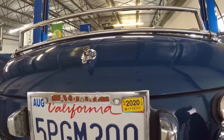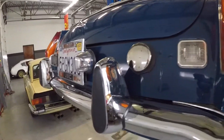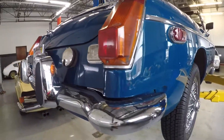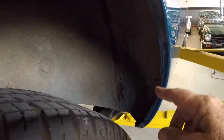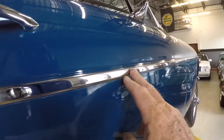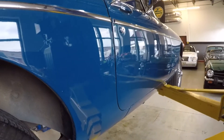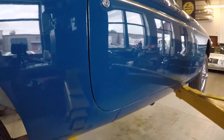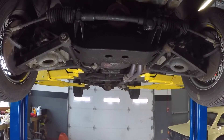The trunk gaps are all nice. If an MGB has ever been hit in the rear, that deck lid gap is not good — look at how even this one is. Even the gas filler cap is in good condition. The reverse light lens is in nice shape, the tail light lens is in nice shape. There's a little rock chip here, and spot welds are visible here. Moldings are good on this side; the driver's side one has a number of little pits, but those are very inexpensive and easy to replace. Flush doors — you don't see that very often on an MGB. The gaps are good on the rocker panels. It's a very straight car.